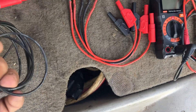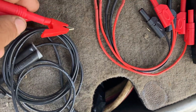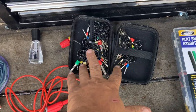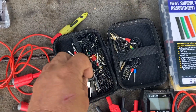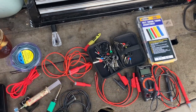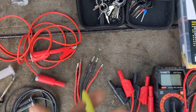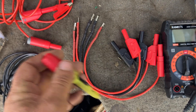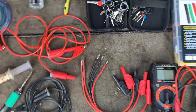As I come across things I need to test, I just go to the junkyard, cut one of those connectors off, make up a set of adapters for the next time I need to do it, and then I'm all set. I made up these longer wires with alligator clip ends so I can alligator clip where I can pull it off and use it — that works really well. This kit's really cheap, I'll put a link below. Also, when you do this, you learn which tool you need to use and how to release those pins from the connector, so when you need to repair a connector you now know how it comes apart. And most wire piercing probes have a banana jack connection, so you can just plug right in there too.